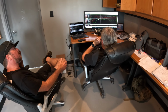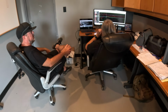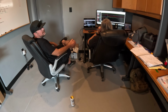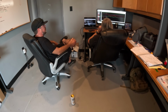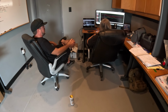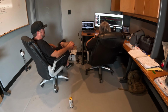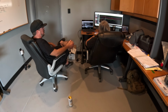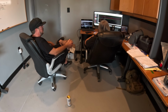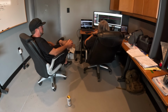Yeah, and it started to happen once we started to make more power. It didn't do it early in the day. We had what, 4 or 5 hits on the dyno, and then it started doing it. Right here we're at 44 and 45, so basically 100 RPM difference. Over here, we're at 48, 49 and 51, a 250 RPM difference. And up here, we're back.